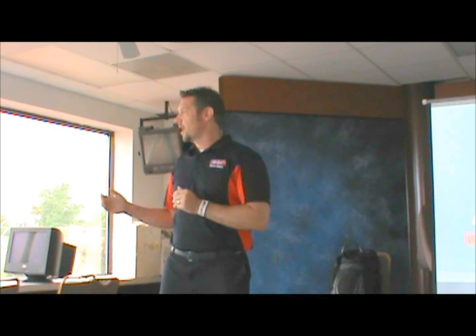If anybody has experience with our M800, our older generation stuff, it's basically everything to run any vehicle all in one box. And the problem with that is that although it's very useful and versatile, it's complicated to use. It just gets overwhelming with the amount of stuff that's in it. So one of the focuses for this kit was to make it simple, to trim out all the stuff that's not necessary for a motorcycle drag racing application, but also leave in and simplify the functions that everybody needs. So the result of that is this M130 plug-in kit.